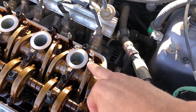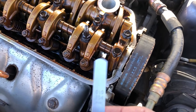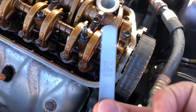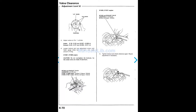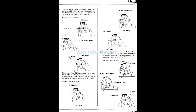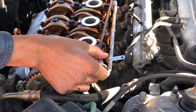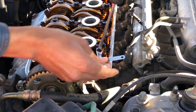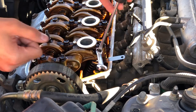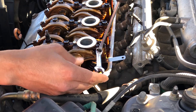After I adjust the intake ones I'm going to do the same thing — check the exhaust ones before I adjust and then go from there with the .25 for the exhaust valves. I'll put up on screen here a couple of screenshots of the step-by-step from the service manual. This is pretty much the setup of the tools right here: you're going to have the box end on the nut and then the flat head on the screw. You're going to loosen it with the wrench, adjust the screw with the flat head, and then tighten it back up with the wrench again.